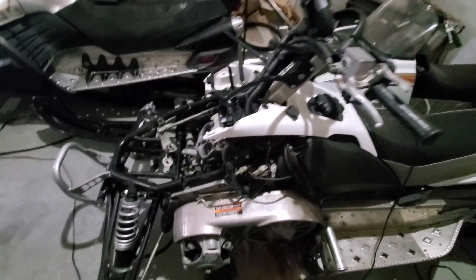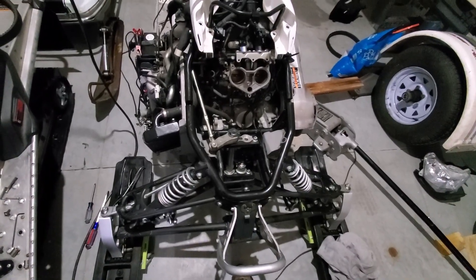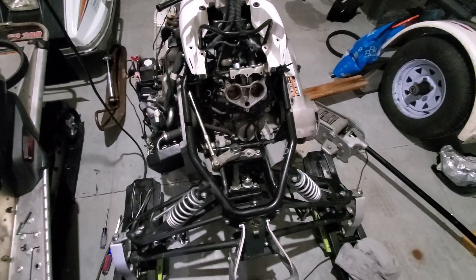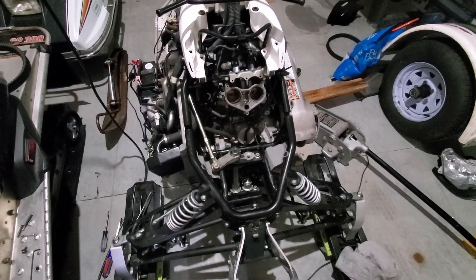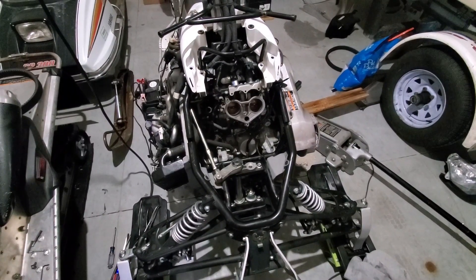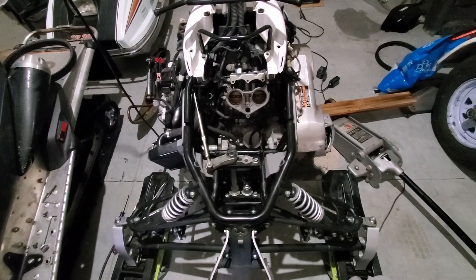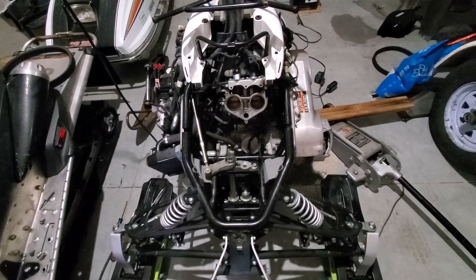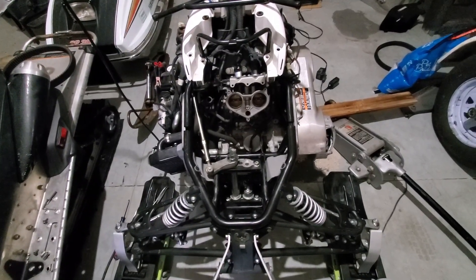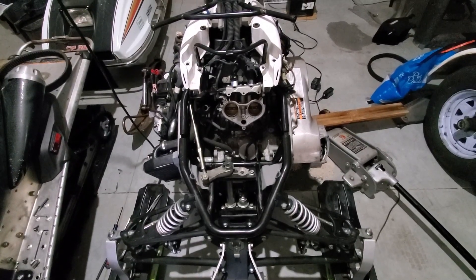So we got the front end put back on and we got the oil put back in the machine. Got the radiator put back on, got all the bolts tightened up. Just enough — I wanted to try to start it and make sure everything runs and works like it's supposed to before I bury everything again, because we did have this thing pretty torn apart. What I also did while I had the front end off: the starters on these are right under the motor, directly available once you take the front end off. The starter bolts were not Loctited from the factory and they can work loose, causing the starter to fail on the trail. So I checked those, tightened them up — they were a little loose, nothing serious — but I Loctited them just to make sure. Also went ahead and changed the oil filter, did all that while I had it apart. Looked everything over real well and didn't see anything else wrong.